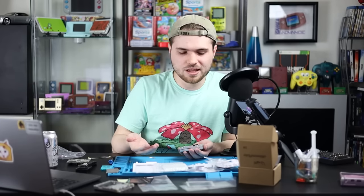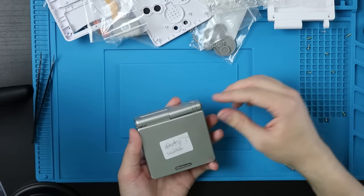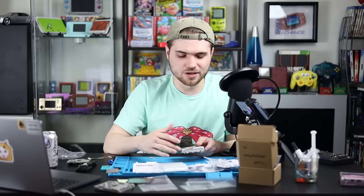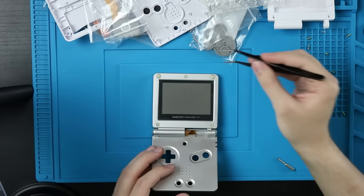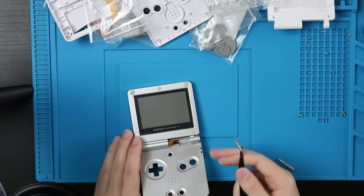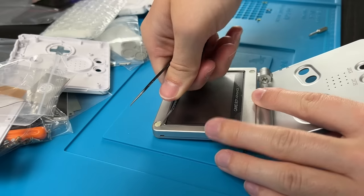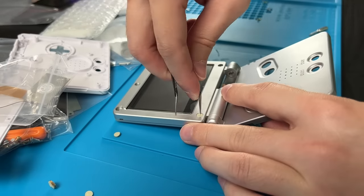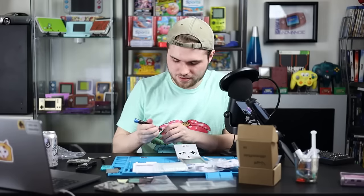Here's where your buttons will probably fall out — that's okay, we're not gonna reuse them. With that last screw gone, we can actually peel this up. Here's one of my frustrations with the SP: you're gonna need these hinges. You can buy aftermarket and OEM hinges, but that does add to the cost of your modding. If you need hinges, let's take care of them. Open this up and grab some sort of tweezer to get underneath these rubber pads — they are stuck on so it might be a little tough.